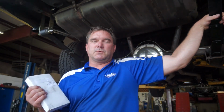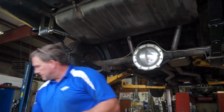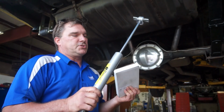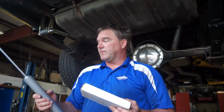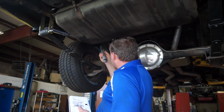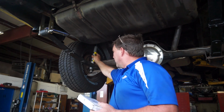And that created a problem with our shocks because the shocks are only like 21 inches long. The air shocks are 22 inches long. So I ended up getting these competition engineering shocks, which we're going to dial down on the soft setting, which is 50-50 dampening for ride quality. And it's got 2 other settings, each progressively firmer. But even these are pretty short.